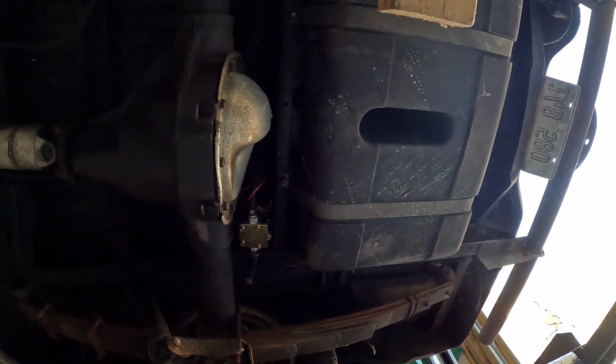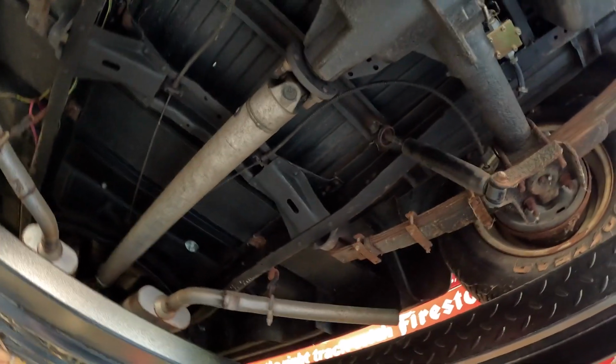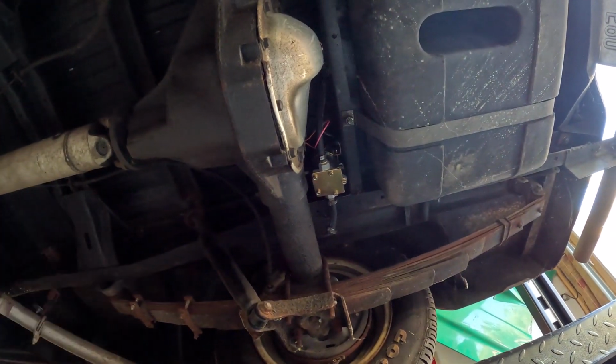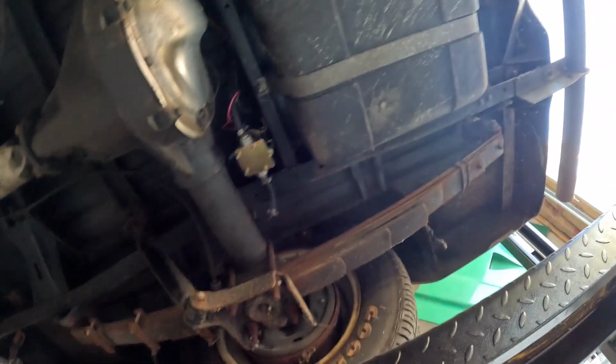And so I gotta replace the fuel tank. I gotta blow out the fuel line, replace the fuel filter, clean out the carburetor. I might have to replace the fuel pump again. I already replaced it once. I might have to do it again because I thought that was the original problem, was the fuel pump. So I replaced it, I remember, a few years ago.